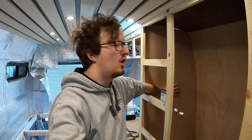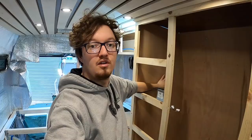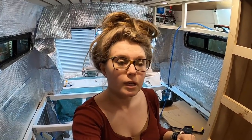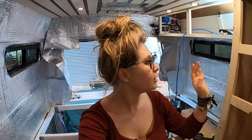The wall is scribed down with a nice curve. We're going to glue the two layers together and screw them all in place at the same time, using a cheap contact adhesive to stick the two panels together. We're screwing through both into the wood, but we just wanted to eliminate any rattle or shake that might happen while driving.